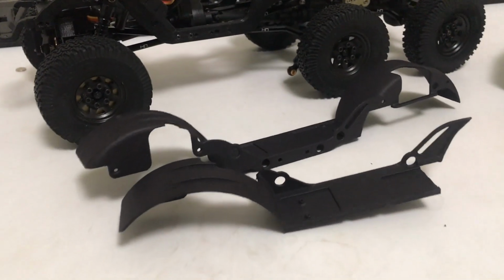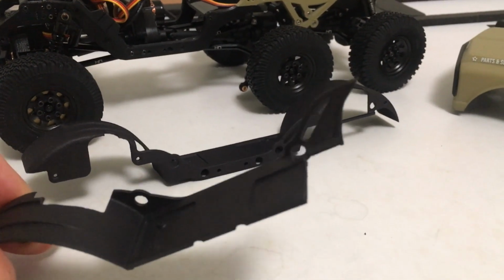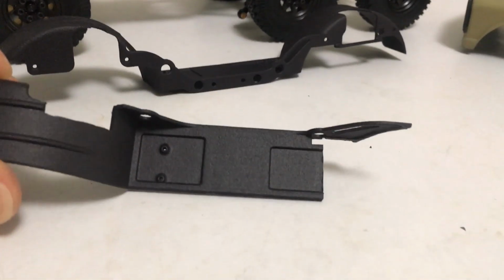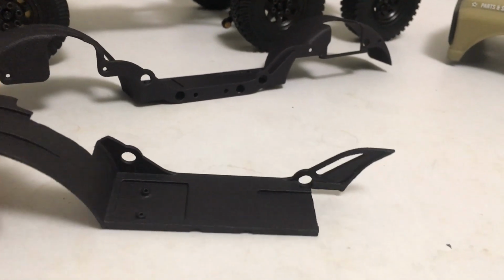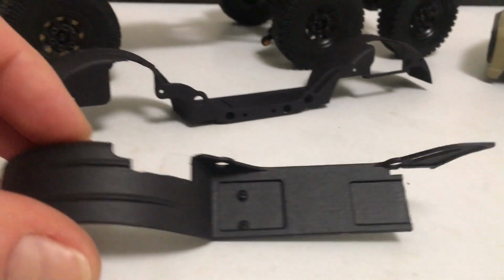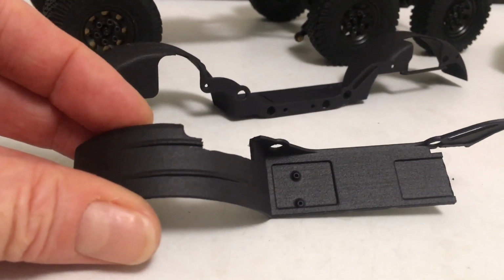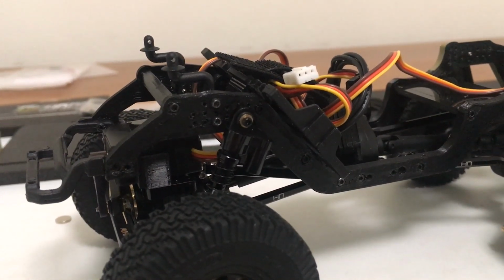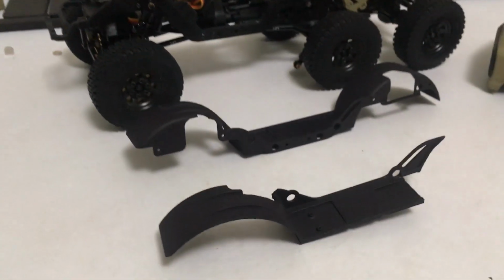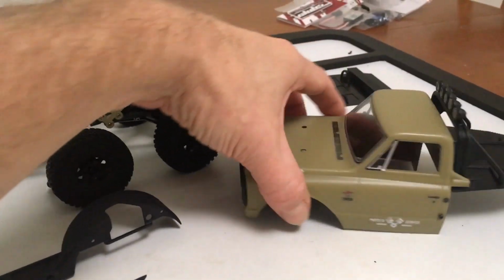And then you can see I've got my fenders out, and I've got my driver's side trimmed up. I did the same as the Valkyrie on the rear, cut them right in front of the 2 screw holes, and then I left the little transitional piece. And then the front I had to do a little different. I had to cut out that wheel well to clearance for the multiple shock hole positions and the fact that that shock is leaning. So that's a little different than the OEM. So now I'm going to cut this passenger side up to match,